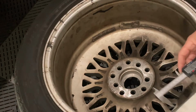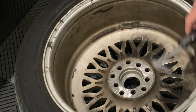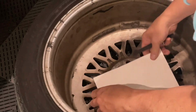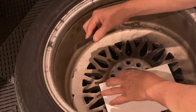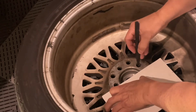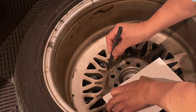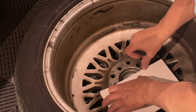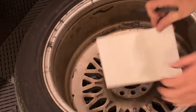I know that is on the inner side of this. So I'll set that one right there, and I'm showing 73. It's like 73, so 58.01 by 73. If I want to, I can come back in here and triple check it. There is nothing wrong with checking this a couple times and making sure that we have the best measurement that we can. So mark that corner right there and see, as I move this around, I think that is the deepest point right there. That's going to be correct.